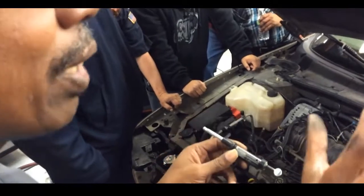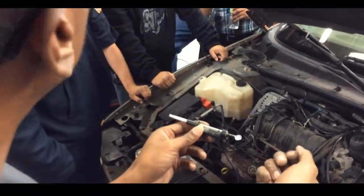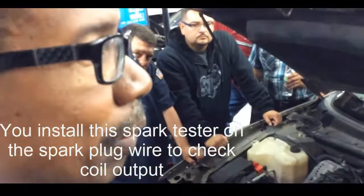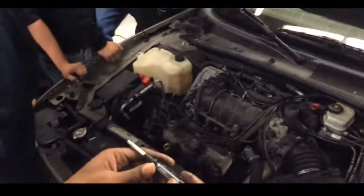I used to keep two of these in my toolbox. I like the other one, the ST125 tester — you don't adjust it, you just stick it on the plug. It's automatic. It looks just like a little spark plug with a clip on it. It gives you the power of the coil. It gives you the power of the combustion channel — it shows what that coil can put out.